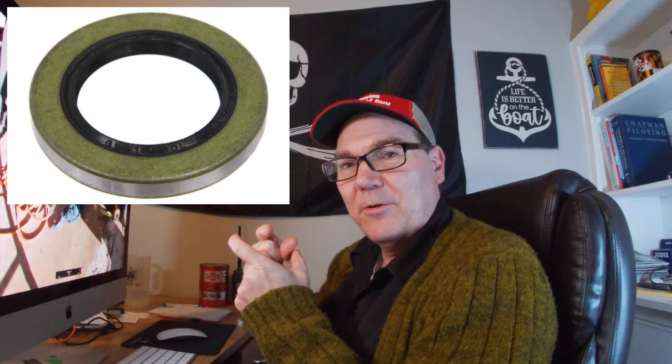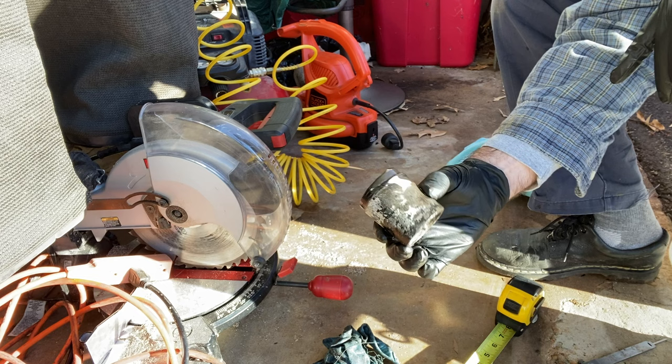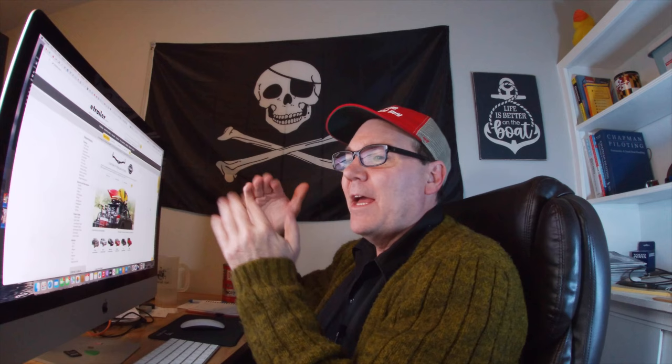Now that we have it all taken apart, we need to measure everything correctly to order the exact right parts. We want to measure the outer diameter of the seal, the inner diameter of the seal, and the inner diameter of the outside since I'm going to order a new cap. Since we're not replacing the bearings, those are the only measurements we need. Where I decided to go to order the parts was eTrailer.com — they are not a sponsor, but they specialize in this and have a variety of options plus a lot of extra information to help you get the right components. Their customer service and website usability make it very easy to pick out these types of things.